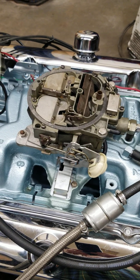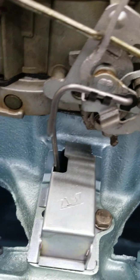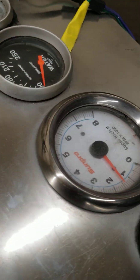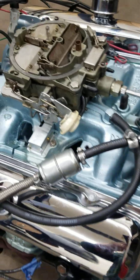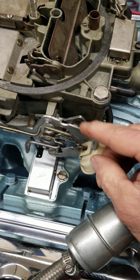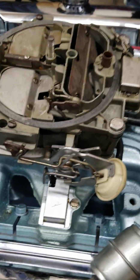That's much better. Now there's an idle speed right down here, and that's what you do to adjust the idle speed. Typically you want this thing to idle right around 1400 - you don't want it screaming. That's about where this one is. Now as the engine warms up, this thing's got a fast idle cam in here, and what'll happen is that'll start dropping off and the idle speed will come down. Right now it wants to be on the faster idle.